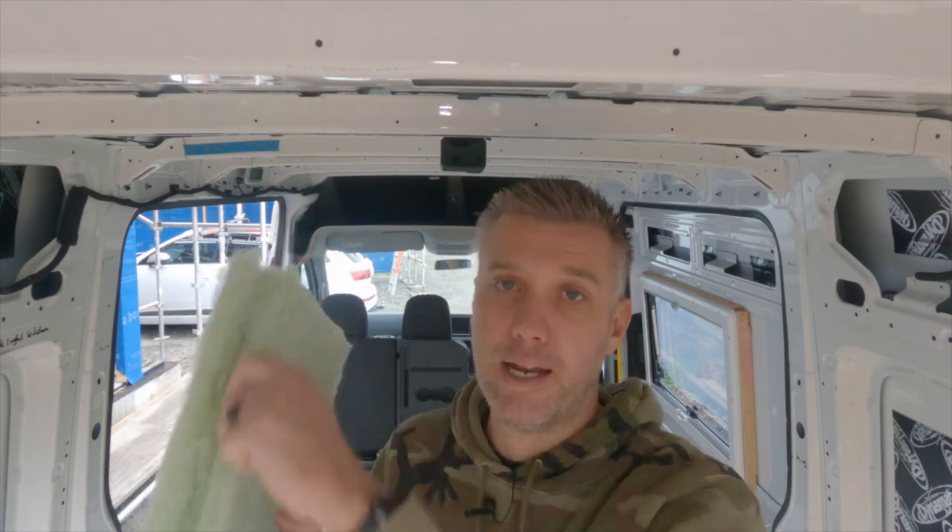It's really easy to handle — you can just cut it with a Stanley knife and then it tears apart easily. I'm actually tearing these bats in two to fit, so the R-value is diminished somewhat, but it's still going to be pretty well insulated compared to a normal van. I'm going to start putting it down, mark the screw holes, and put the floor back in. There are going to be a couple of loose joists because of the passenger seat, but the floor will be mostly screwed down so we can move forward with building the cabinetry, and it'll be easy to unscrew and pull off when we need to put that passenger seat in.